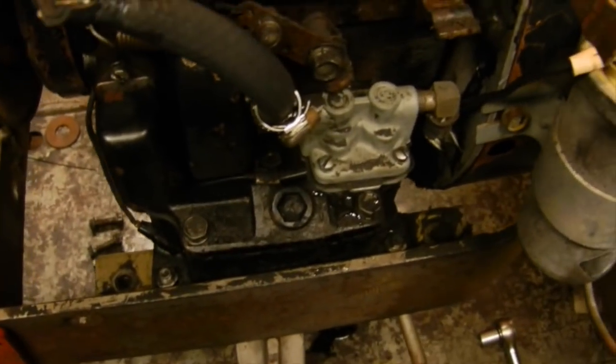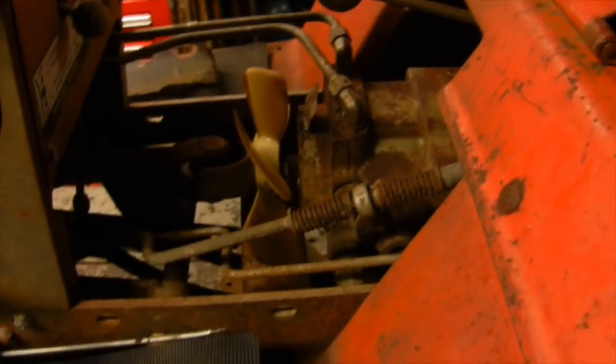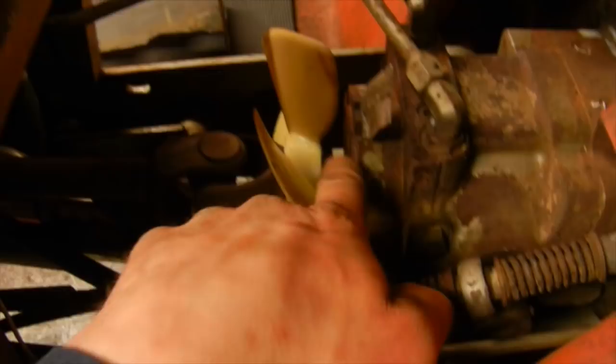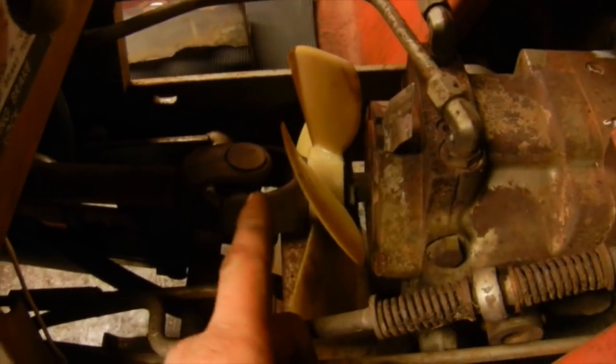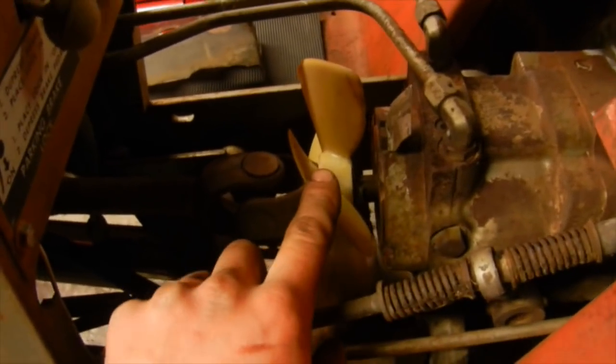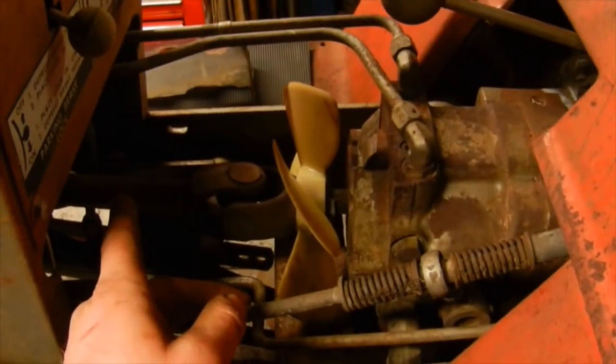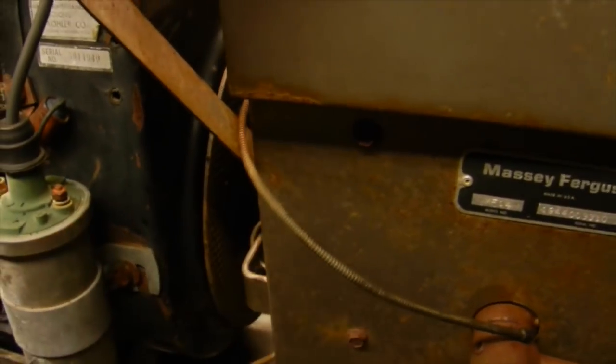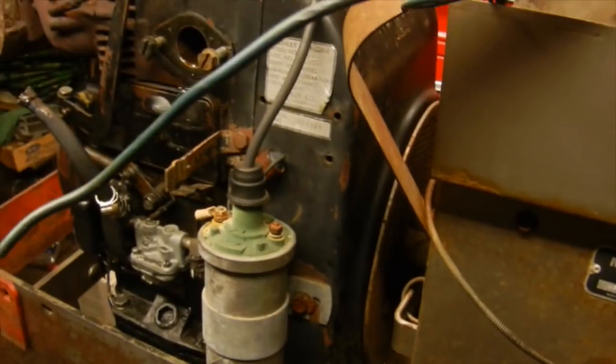So all my bolts are out from the mounting holes down below, and I also pulled my other cover off of the transmission tunnel, so that way I can see my drive shaft, which is on a spline shaft, so everything should slip forward okay. I don't think this fan's going to fit through everything here, but if I can get the engine to go forward some, I'll have enough room to take the screen off and take the adapter off that the U-joint bolts to on the flywheel, and then I can pull the engine out. So let's see if we can get everything to move here.